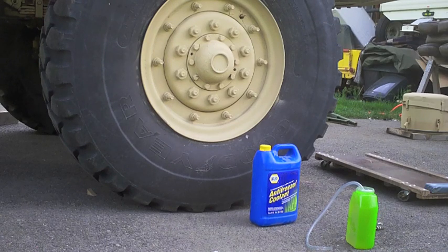I'm getting ready to fluid balance these big 1420 tires on the M923 because it hops a bit. I'm using an old farm trick — instead of salt water, I'm putting in about a pint of antifreeze. Fluid balancing has been part of agricultural life where tires are filled with fluid so they weigh more, and as a result they self-balance.